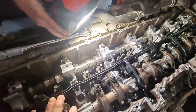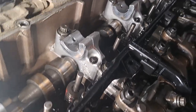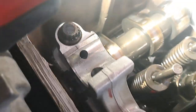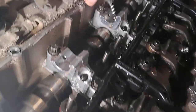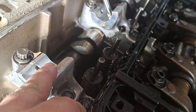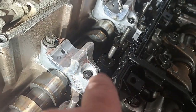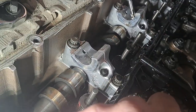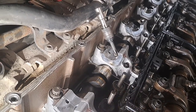Looks pretty good to me. We found this front one up under the light — it's bad too. Probably should do them all. Anyway, we got this one tapped and we got the time-sert put in and expanded. We ran a bolt down through the broken piece of shaft — it looks like everything's going to be all right. It tightens down. We've got new bolts for our torque-to-yield. I'll help Brent get this one in — we have a little clearance issues here.